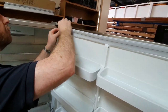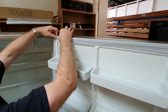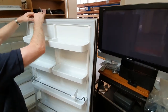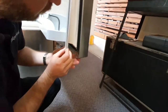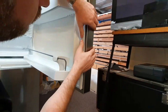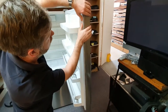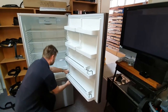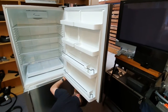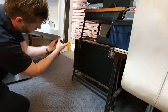Do the other corner. Once you've got the top two corners pressed in, the seal will just hang and you can work on the bottom. It's just a matter of clipping that dart into the plastic channel and working your way up. We do like to sometimes start from the bottom and work our way into the middle. Fisher & Paykel are probably the easiest door seals to replace yourself, so I'd highly recommend giving it a go instead of paying someone at least a hundred dollars to just clip it in for you.